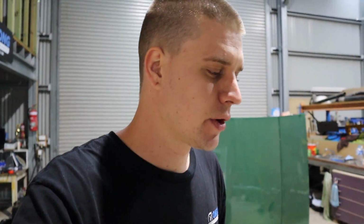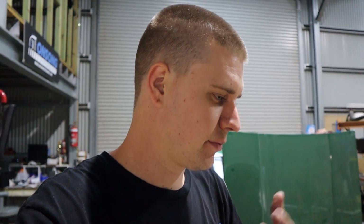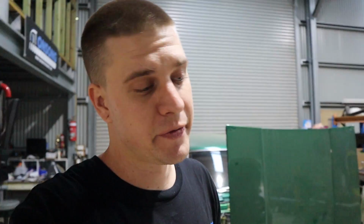But as we were talking about this morning, between me and Rex, it's sort of a double-edged sword, because the faster you're pumping, the faster it's moving through the cooler anyway. So the longer it sits in the cooler, potentially the better it's going to be. So it's going to be a matter of finding that happy medium. The 15 litre per minute one may actually work pretty well with this setup. So we'll just see how it goes. We're going to run it anyway.